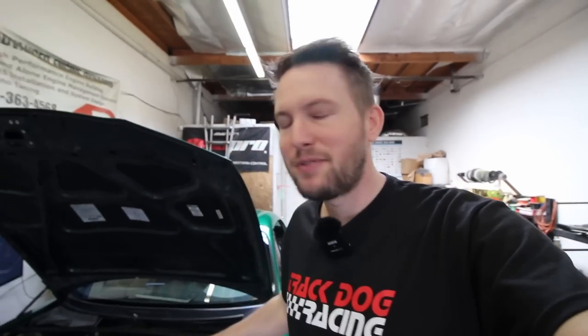Predictions for today. I know in a previous video, it made 207 on virtual dyno. First thing I'm gonna do, baseline pull. See what it makes. My prediction is that it is gonna be somewhat close to virtual dyno, but typically what happens is as soon as I put any of the cars on the dyno, they start misfiring. We have to gap the plugs down. So I think it's probably gonna make like 190 on the first pull, probably have to gap the plugs down, and then we'll be up into the low 200s. And then I'll start playing with ignition timing.